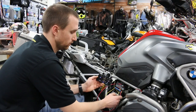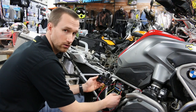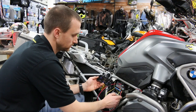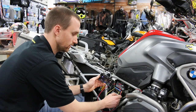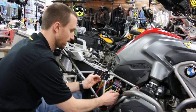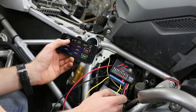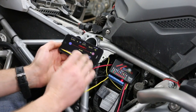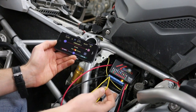Now I'll give an example of what happens when you have a short circuit. Normally with a fuse system, the fuse blows and you have to go find it and figure out what's going on. With the Neutrino, when you cause a short circuit, you get a red indication on the LED on the Neutrino and the app tells you circuit one flashing red has a fault. To reset, simply remove the short, turn off the circuit, turn it back on, and it's restored to full function.